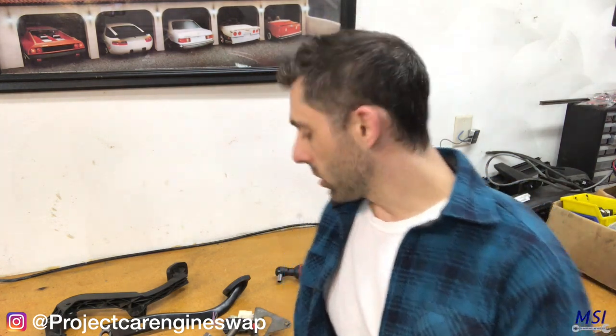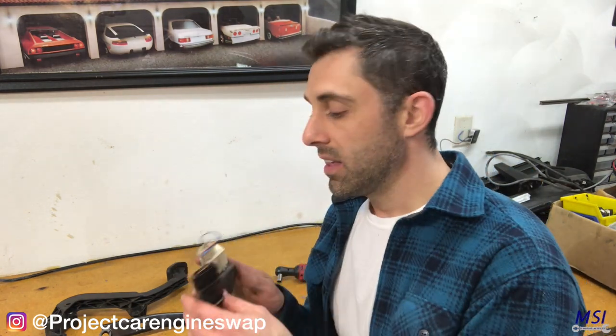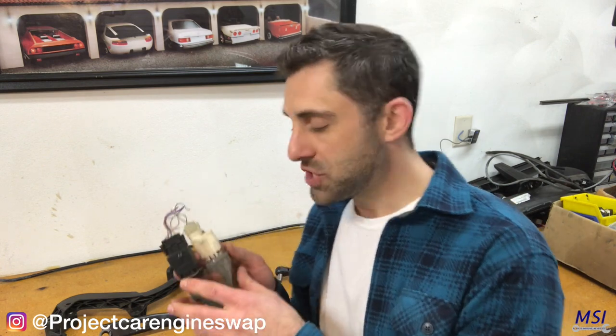Good night everyone. I'm Frank Macaluso and thanks for tuning in. Today we're going to be building the manual brake and pedal clutch assembly for the E36 M3. We have an N54 going into it and it was originally automatic, so we're going to be putting in a manual pedal assembly for the manual transmission. It's going to be a six speed. We are also going to be integrating the brake and the clutch switches. The clutch switch is particularly important because it's responsible for not only allowing the engine to turn on, but also may be used later on for cruise control.